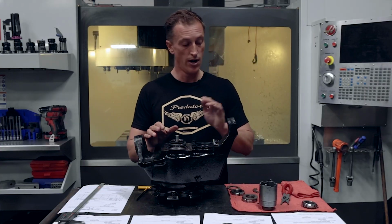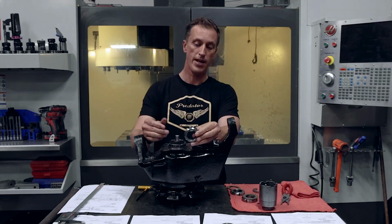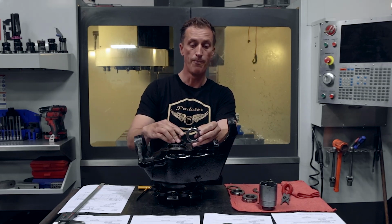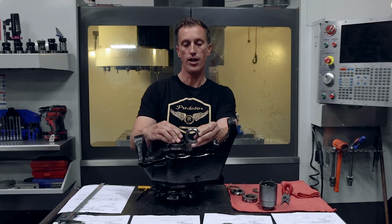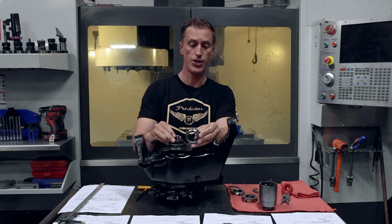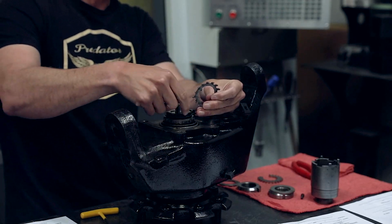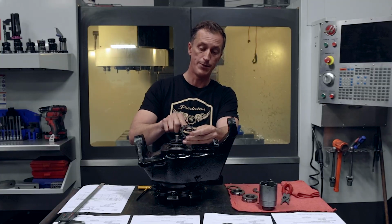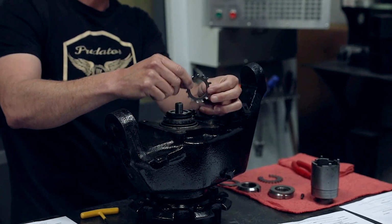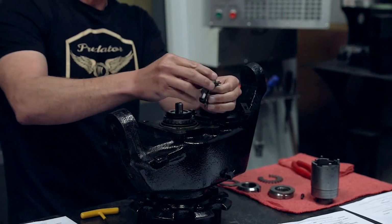So now this is in line with the original Humvee nuts. The advantage being is that you can put a wrench on, or a socket on this guy, no problem. But it's gonna fail too the same way. It's gonna give you a false sense of security, which is just not there, because eventually it will fail when that little tab right here fails. So when that gets eaten up, it's both shorter and also narrower. And so it just has all that slop and starts eating away itself. And eventually when it's gone, it's ground down, it falls off.